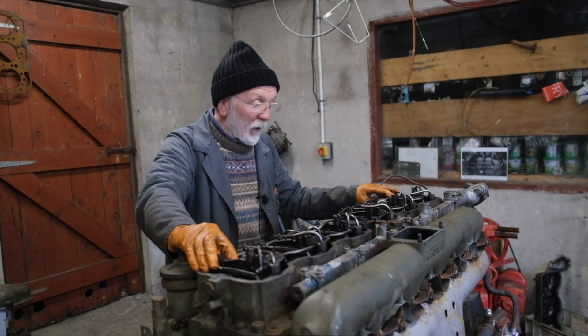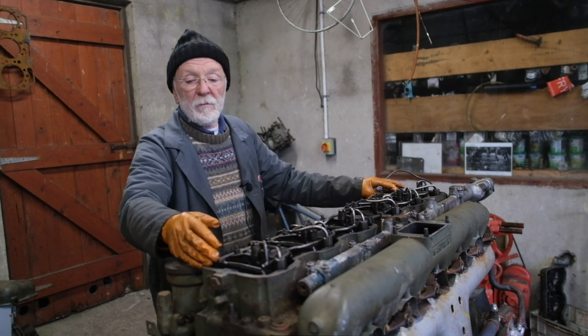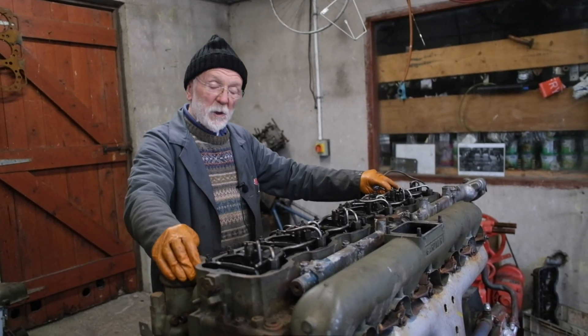While having a cup of tea, my son Brendan and I moved the flywheel round to the number one mark. So we know the piston is at top dead centre.